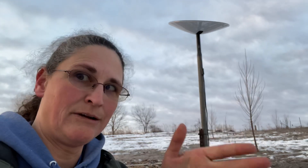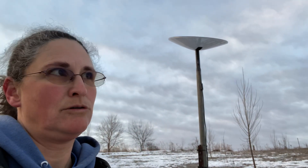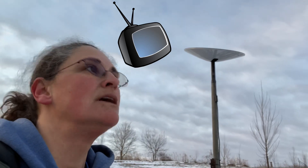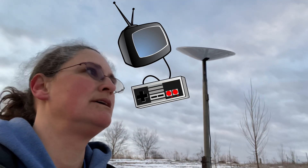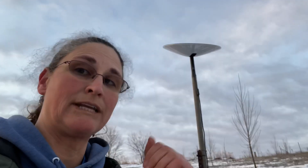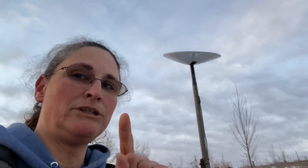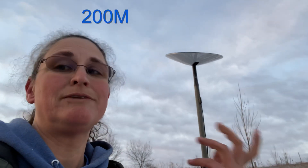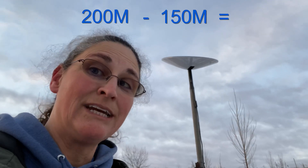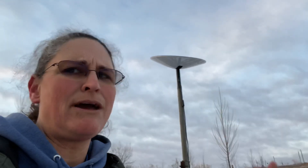For those of you that don't understand how a speed test works, a speed test only shows you available bandwidth at that moment. So if you're streaming TV, downloading games, downloading something else, watching other videos — every single piece of equipment in your house is currently using internet. So when you run a speed test, it will only show you available bandwidth. So if you have a 200 meg circuit and you're using 150 meg of it, your speed test is going to be 50 meg. So keep that in mind.